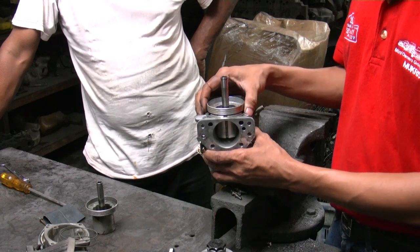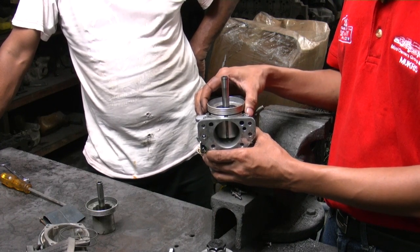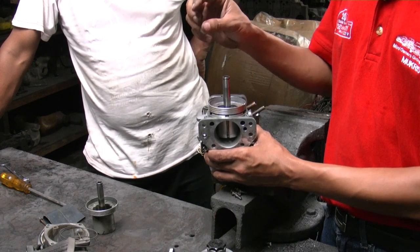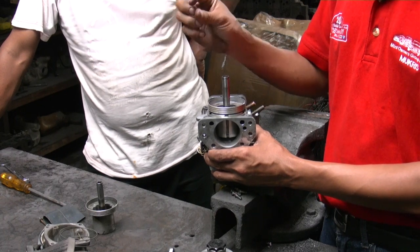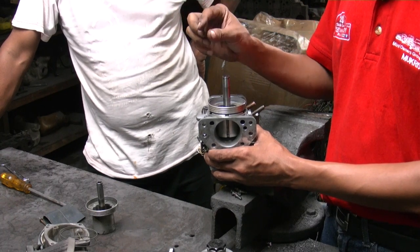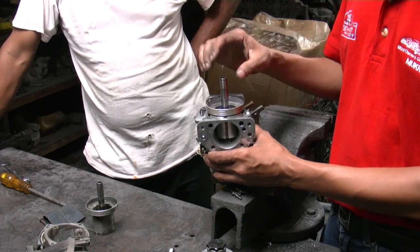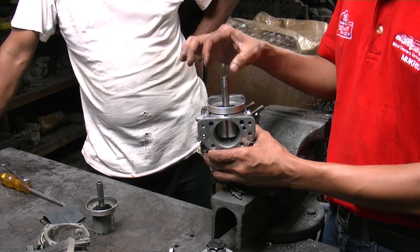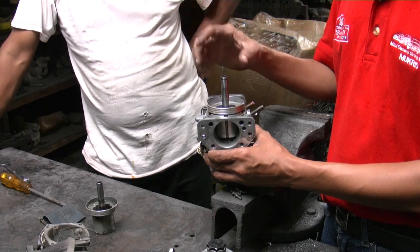So if I wanted a light oil, little damping, I want it to respond quickly, what light oil do you use? Usually, I'll put a bit of ATF fluid mixed with an engine oil. They do sell a proper dashpot oil, but they don't have it here. So that's why we do our own mixing.